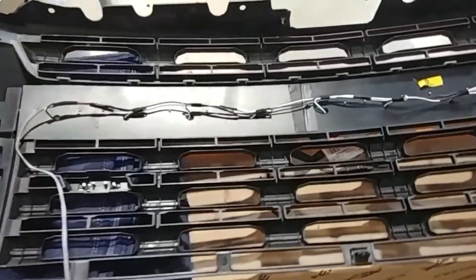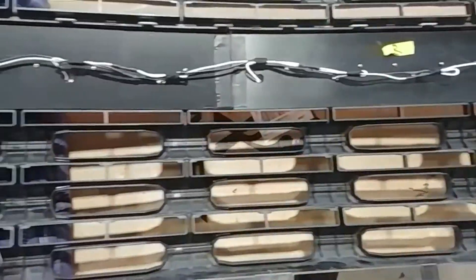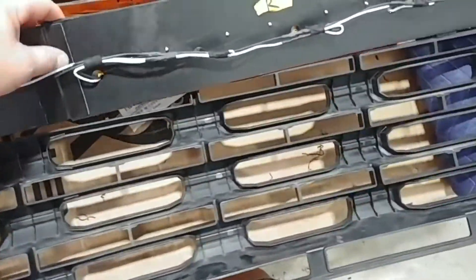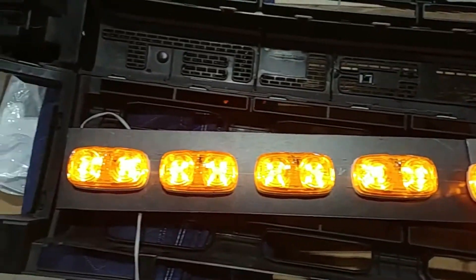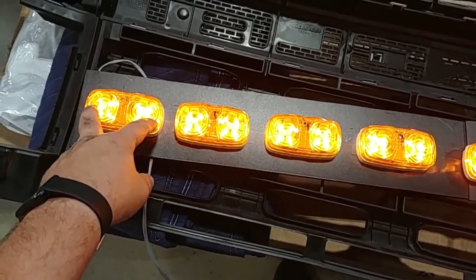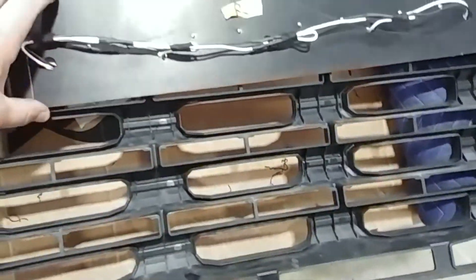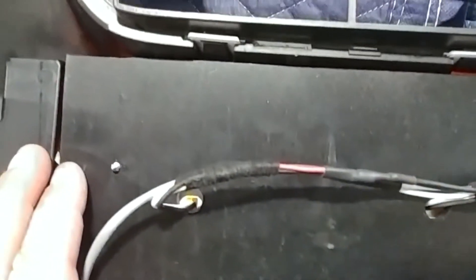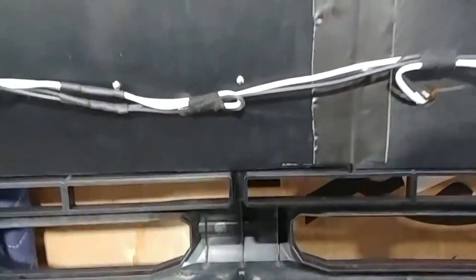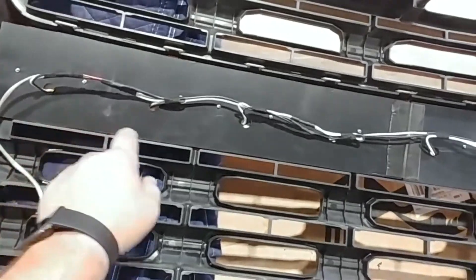So I fit the plastic — I did go with the smaller plastic and it actually fit in there pretty nicely. I've lined up all the lights on the ABS plastic. We've got all of these lights here, centered them up all behind the letters as best I could. Popped the lens off, screwed them into the ABS plastic with some stainless steel screws under the lens. We're going to flip this whole assembly forward and it's going to nestle nicely right down in this groove right here. We've cleaned out with a die grinder everywhere we need it to, and now we're going to hit this with a little bit of industrial hot melt to secure it and seal up any other light stops.